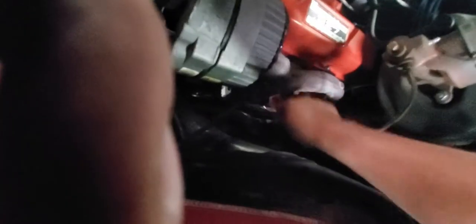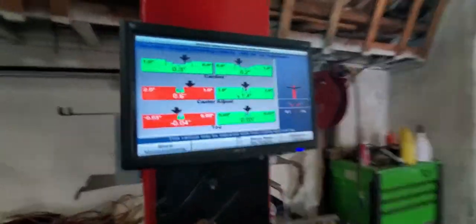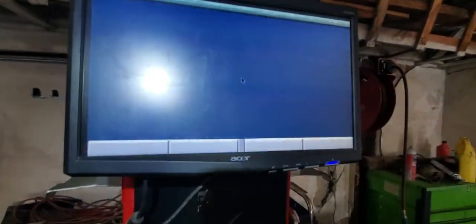This is really hard. Watch your fingers with these things — they hurt a lot, trust me. On this side we're gonna be adding shims. You can see the machine is compensating for the weight of the car. As I add shims on this side, the other side went a little bit down — that's what happens when you remove shims, it tries to compensate all the time. So I'm gonna do the caster measurement again.